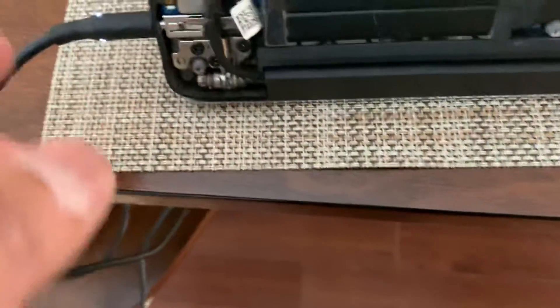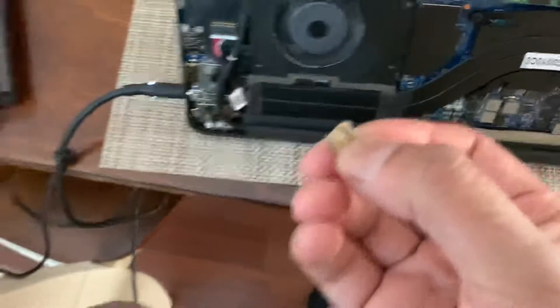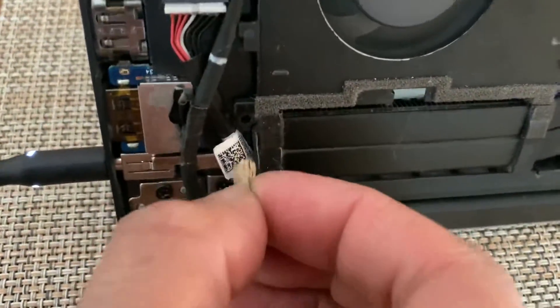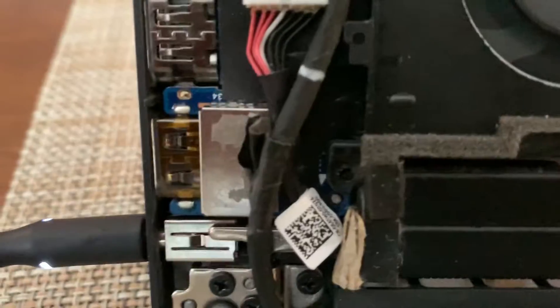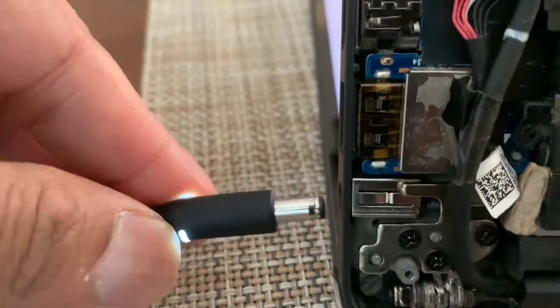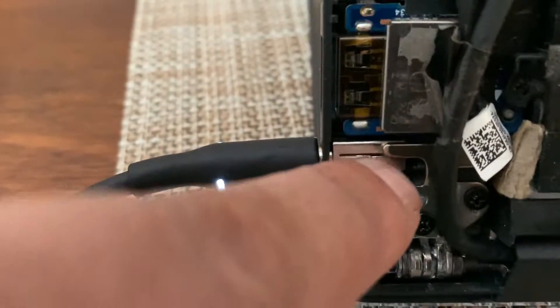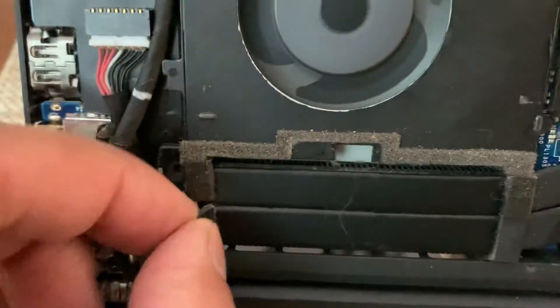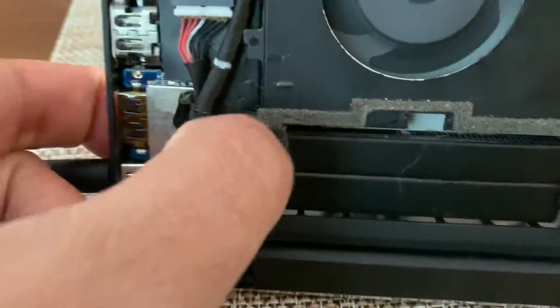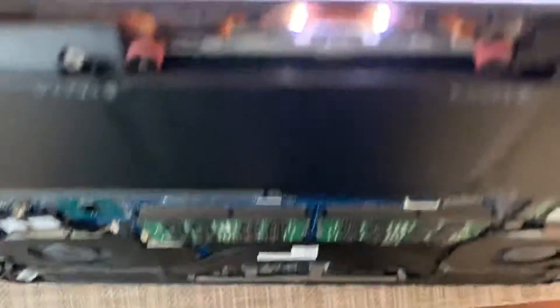To fix this, what I did is I took a small piece of cardboard and stuck it in between the wire for the DC jack right there. You can see this piece of cardboard — that pushes up against the DC jack so when I stick the adapter in it doesn't slide back as much. The alternative solution would be to stick something inside this gap, but either way you want to put pressure on the wire for the jack or the jack itself so that it doesn't slide back. I may use something a little bit thicker once I'm done.